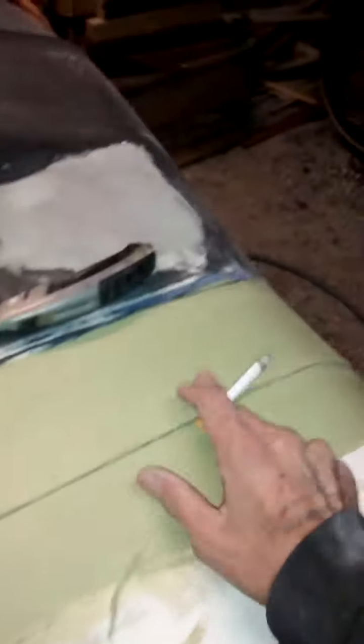It has four rubber stoppers all the way around the hood for it to actually lay on. Then I did some body work to get my lines tight — the gap around the hood. I just got done with that and cut it out with a knife, used little strands to open the gap up, then pulled everything off — took the hood off — and sanded them back down.